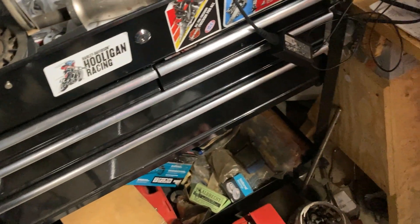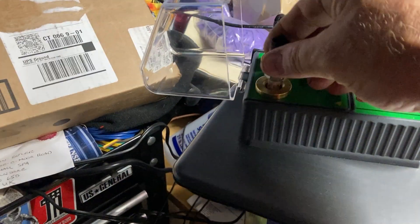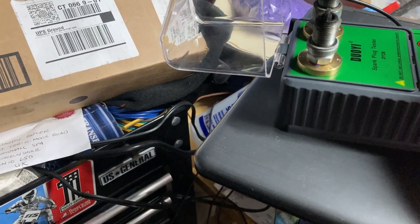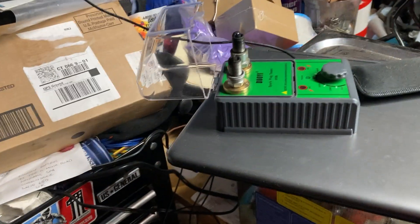Here's the infamous RC12YC - these are in just about every overhead engine. Let's see - let me turn off the light to show you what's going on with this one. There you go - it's shorting on the bottom. I'm not going to touch it so I don't get electrocuted, but yeah, it's a crisp blue spark up top, but it's shorting down there. So who knows how it's going to run on a machine.